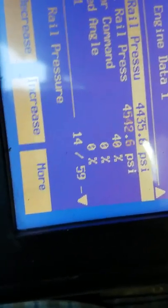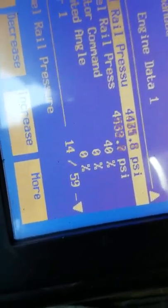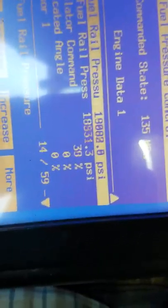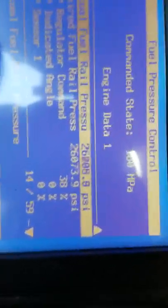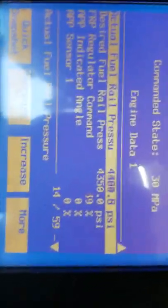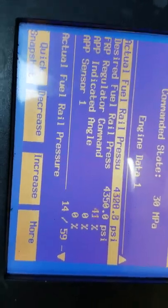Look at the numbers on the Tech 2 — they're quite even. If it's a low pressure side, the numbers often won't climb fast. I'm going to increase it now; watch how fast the numbers follow — 18, 20... and there it is, 26,000. That's the injector that's bypassing — that's our leaker. It's going to make a funny noise when it calms down. That's the one that's bad and needs to be replaced. We're going to put two injectors in — one on that side, one over here — and that will get rid of the limp mode.